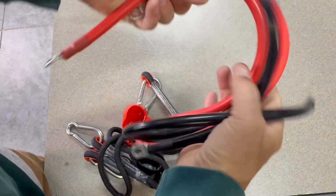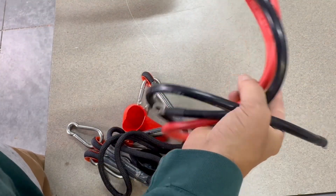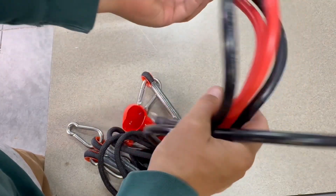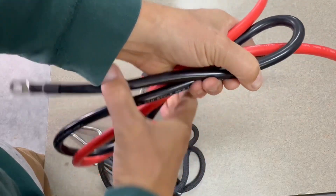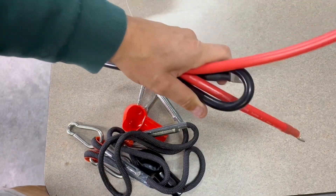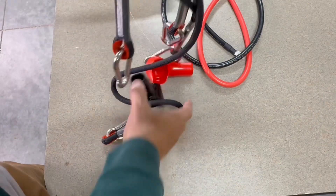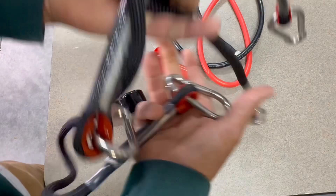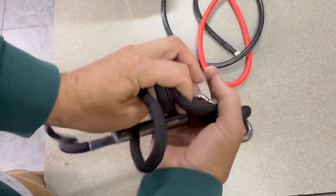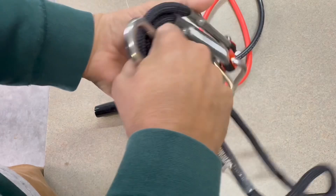What comes with it: there are two 2-gauge, 200-degree Celsius rated cables, which is actually really nice. They could have gotten away with 4-gauge cables, but these are probably meant for paralleling batteries together too. And then they give rope handles to be able to lower the battery into place — you could just leave them attached if you wanted. Those are beefy for sure.